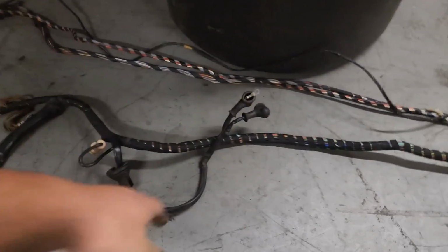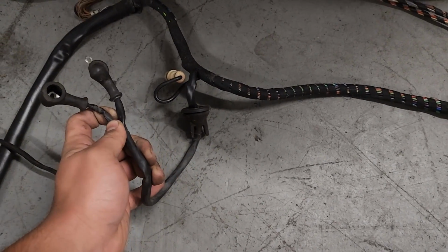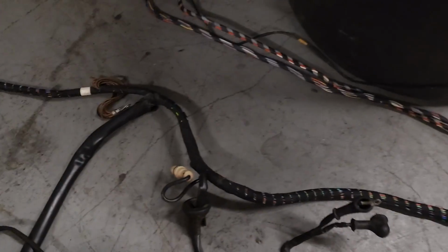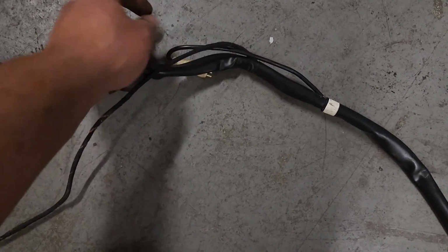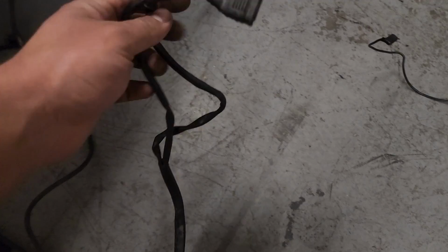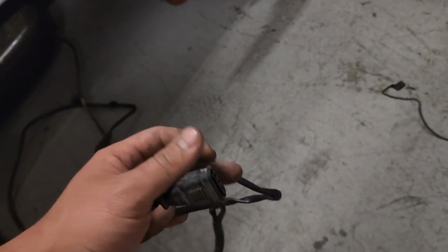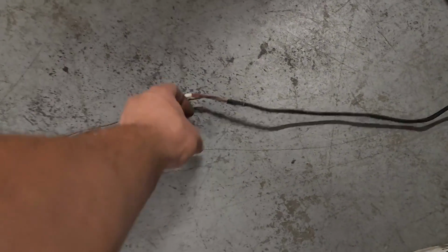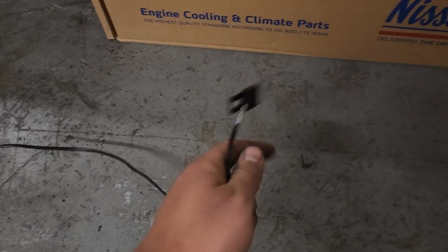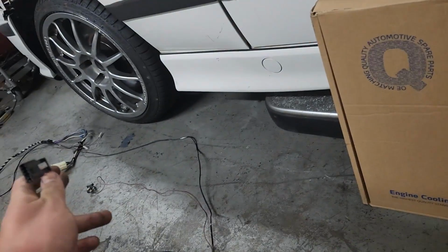Continuing back, this is still considered an early model car, so it had a separate external fuel pump. So this is the wiring to that, ABS sensor, more grounds. We're going to come across here to another ABS sensor right there. Coming down, this goes through the rear back seat underneath to a wheel speed sensor right there. We have our diff plug for the speed sensor, and then we have our fuel pump and our fuel level sender right there. And then coming back down, wiring up for the passenger light in the B-pillar. I left the wiring in the car because I didn't need to take it out. And then that continues with the light switch to the front, as well as the gas cap lock for the front, coming off the front there.